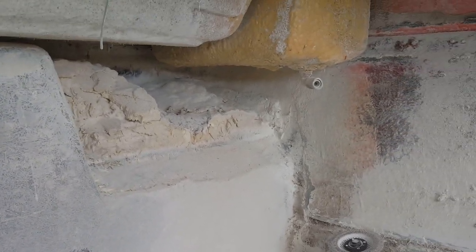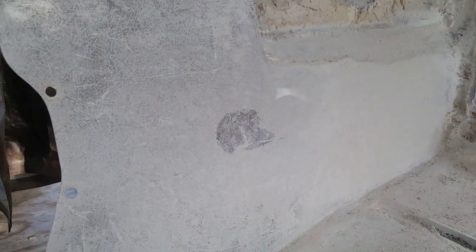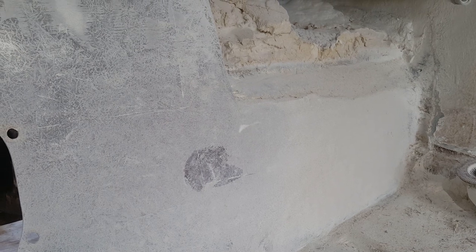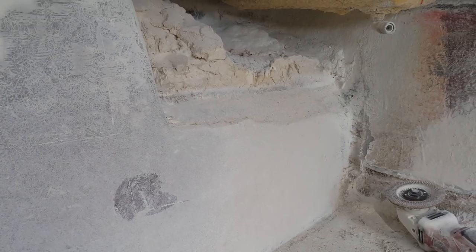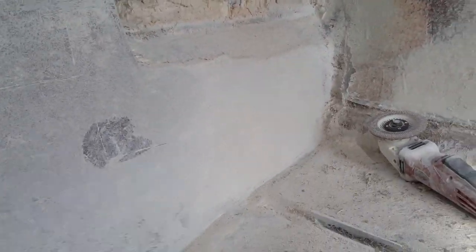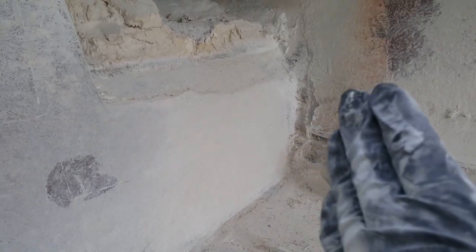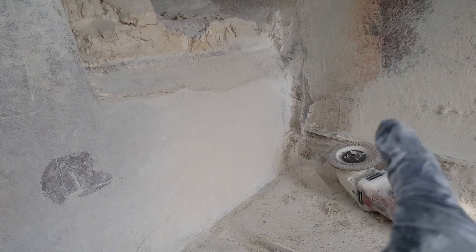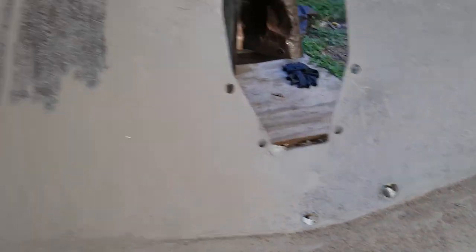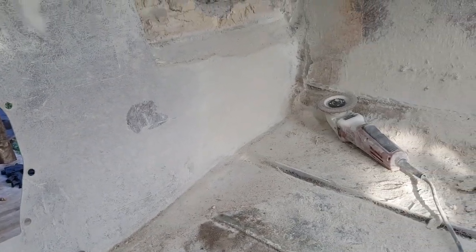I looked up in that area where the rotten wood was on this side and it looks completely encased still — I don't see any issues there. I'll probably go underneath on the outside of the boat and try to pull on that bolt device to check if it's rotten, just in case. It seems pretty well sealed. I'll finish removing the excess strands of fiberglass on that corner and that's going to call it good for the transom.